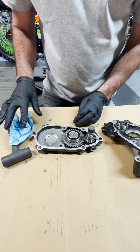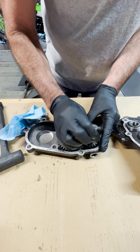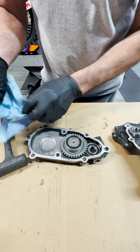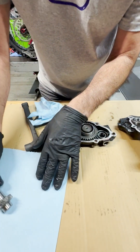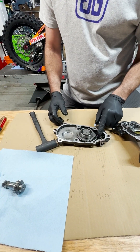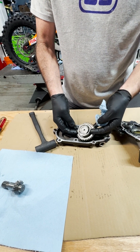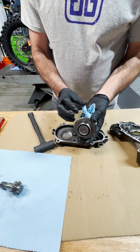Because we have the whole Dirty Bike Bearing and Seal Kit, we'll do two more. The input shaft — put it to the side and try to keep all of this stuff clean, because it's got to be clean when it goes back together. You don't want any contaminants inside your case. And then this idler gear, the center gear — now we're going to have to get those bearings off.